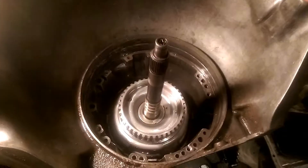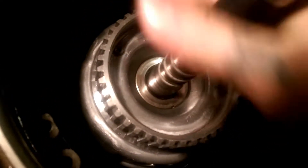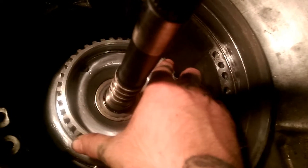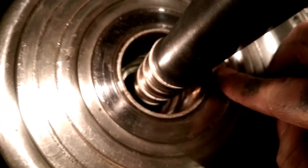Once you get this set down, you can pick up on it a little bit. If it makes a thud, it's good to go. That drum does the same thing - you got to set it down here. The clutch is going to spline onto this, and you got to wiggle it and work with it on that part. This is what your input drum will look like for reinstall. You can look down here and make sure it is seated, right down in that crack. It's very close. You can shake it - looks good. The clutch is very easy.